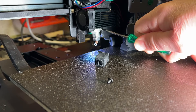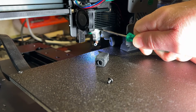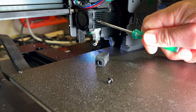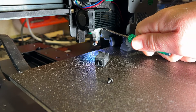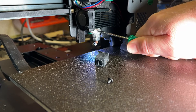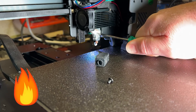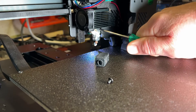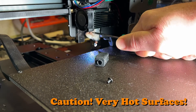Right in that big hunk of filament that crept out the silicone boot. This also gives you a chance to see the cooling fans and all the other parts included on the Artillery X4 Pro. Not quite hot enough yet — you can see it starting to move. At 222 Celsius you do not want to be touching this with any part of you because that will burn. And there it goes.